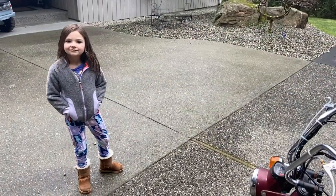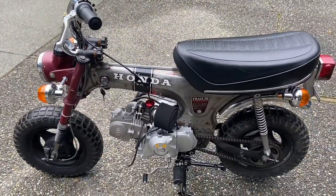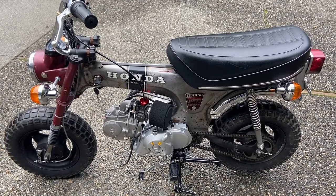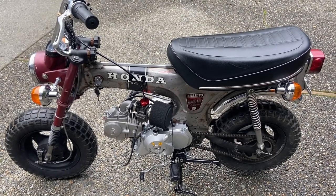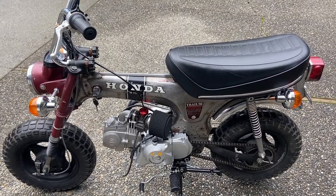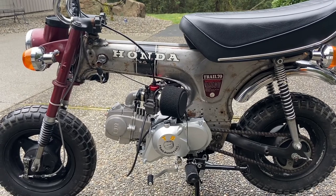Was it fun? Yeah! So overall, done for the most part with the carburetor. Might need some adjusting on the air-fuel mixture screw, but it looks like the 100 main jet was the ticket. I can definitely hit the higher RPMs now.